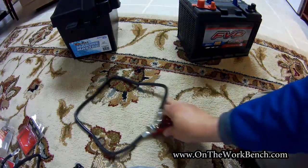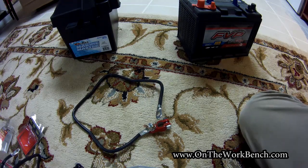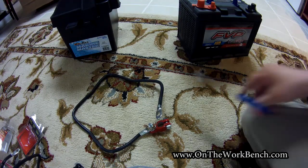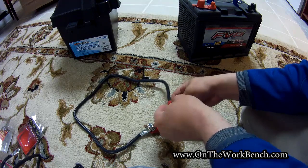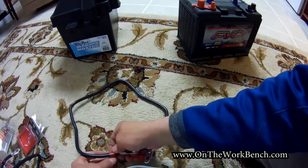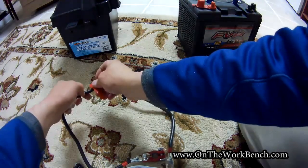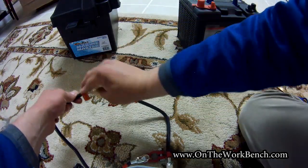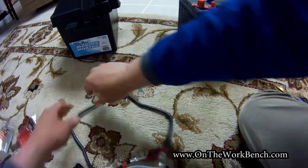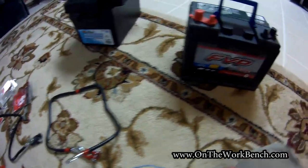Before we go any further working with this here, we need to deal with this battery cable — it's black, but it needs to be red to indicate that this is for a positive terminal. So I'm going to mark this with some red electrical tape just to ensure there's no ambiguity that this is a positive cable. Put some red electrical tape around each end, and also somewhere towards the midpoint. Now we can clearly tell that this is the positive terminal cable — at all ends, we know it's positive.